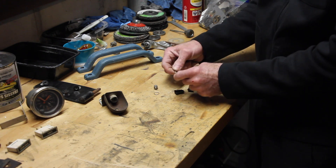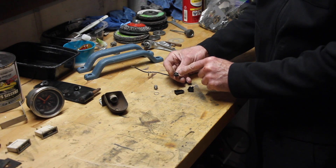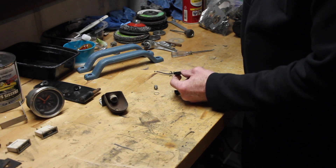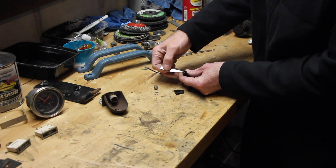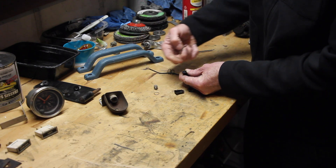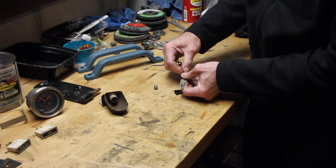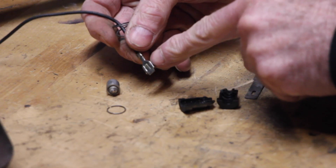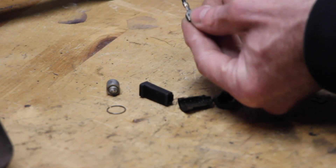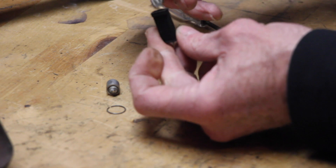To clean all this stuff up — if it's corroded, make sure you've got this contact point here nicely polished and cleaned up. Make sure you've got a good connection with no tarnish or corrosion on the end of this, and also a nice clean connection on the inside. To get inside of these — you can see how there's a notch on the top part of this connector. Inside of there is a little wire prong. Get something flat and long, push into that, and push the wire prong down, then pop this thing out. Before you put this back into its plastic housing, push that wire prong back up so it locks into place.